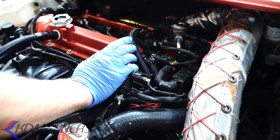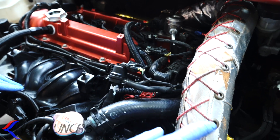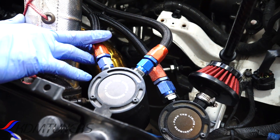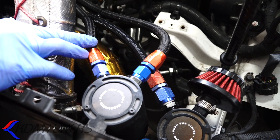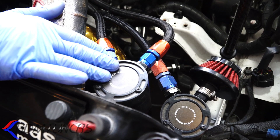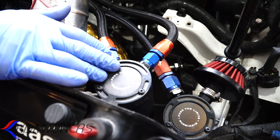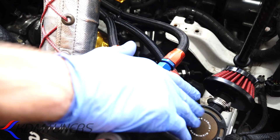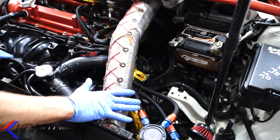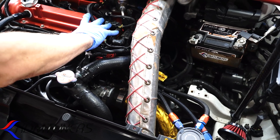What people are doing now to combat that is adding catch cans. As you can see over here, we have our catch can set up. Catch cans serve a great purpose to catch all the oil and everything coming out of the vents. What they also do is cause a restriction to the system — inside the catch cans you have a baffling system, and the air and pressure have to get through all that baffling to be vented out into the intake manifold or out the vents.